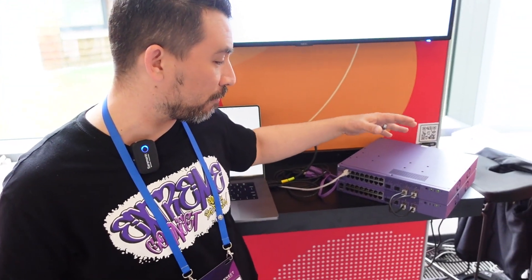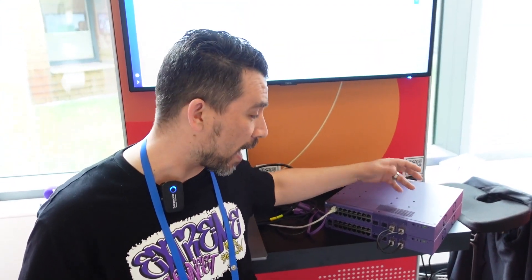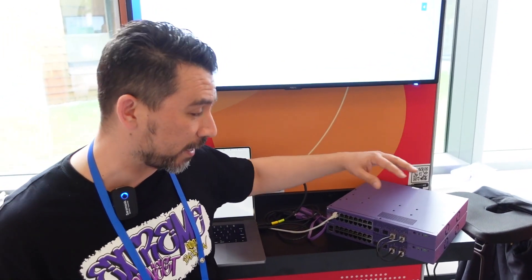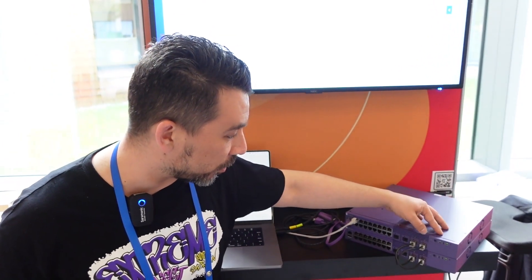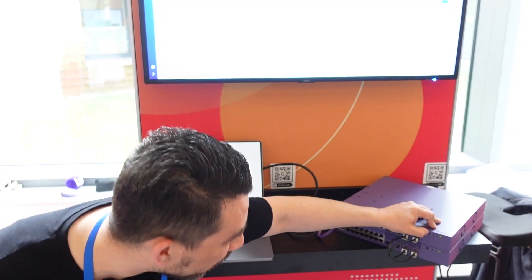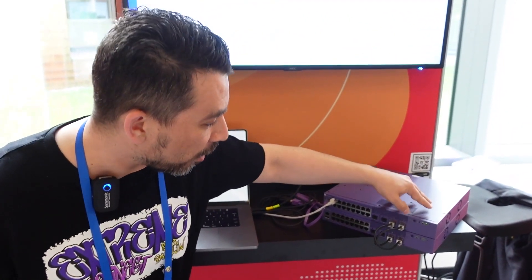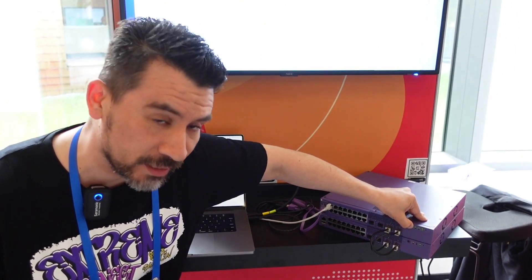It's so simple — you literally take the switches out of the box, plug in your power cables, plug in your stacking cables, and now you can enable stacking with the push of a button. We use the mode button and push it to get to the STK LED, then hold the mode button down for five seconds.